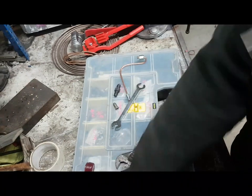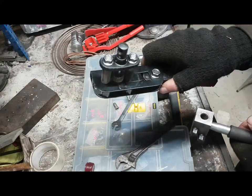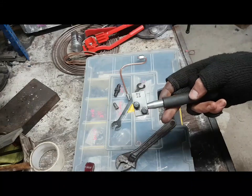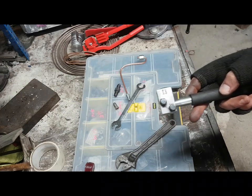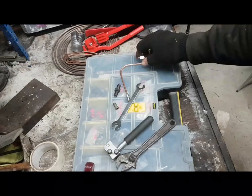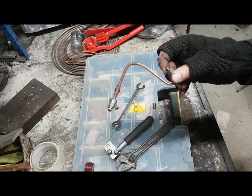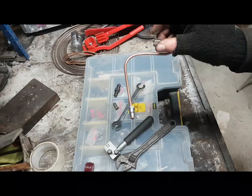And as I say, they're much, much easier to use than these fellas, this style, which I bought 1,000 years ago because I needed to make a brake line up for a Land Rover. So I guess when it comes to buying kits from various companies that do kits specifically for a car, especially classic cars, let's say you've got a Triumph Stag, go and buy a complete box of all the brake lines required for a Triumph Stag. What I've generally found from my experience is the brake lines are always too long. They're often made out of copper. And while the fixings on the end may be the right measurement, they may not necessarily be at the quality you want them to be at.